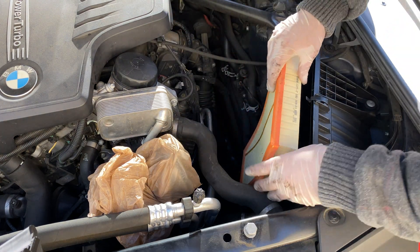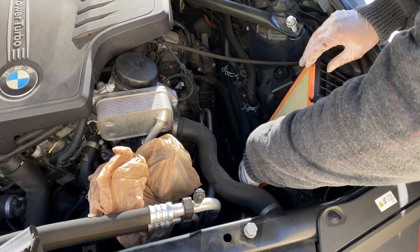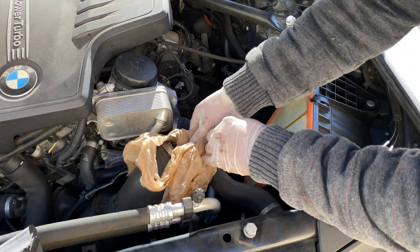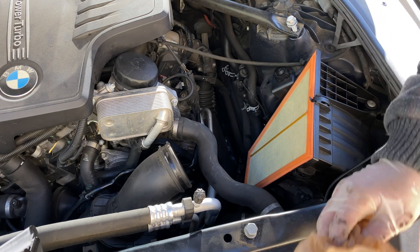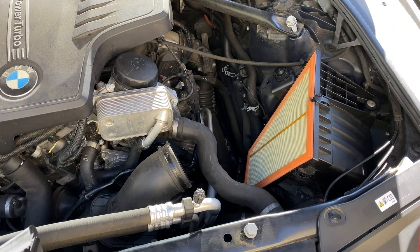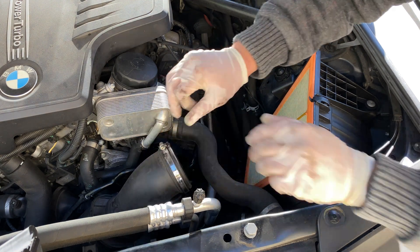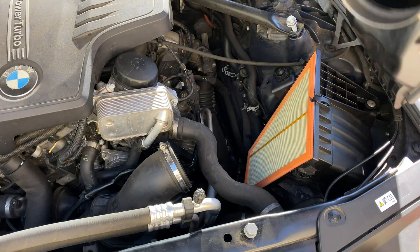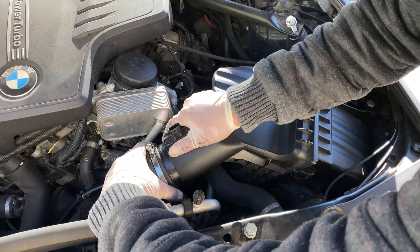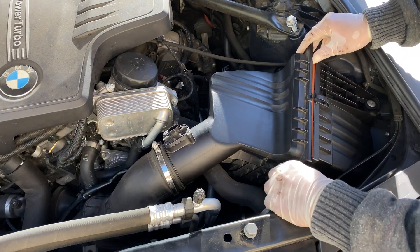Install a new air filter, or if yours is already clean, put your old one back in. Now take the bag off your air intake that we put on to prevent contamination — make sure it's nice and clean. Don't forget to put the hose clamp back on. Then put the clean side of the airbox into place. On the bottom of that airbox there are some grooves — push it into place so it catches, then it swings on the top side to clip into place.